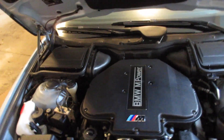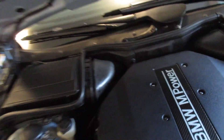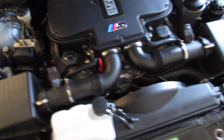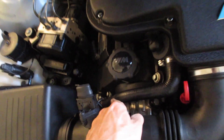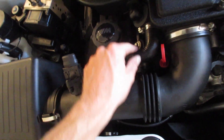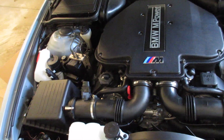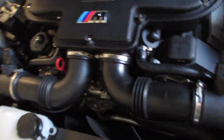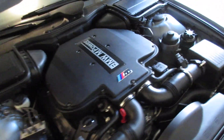I'm really happy with that. It's just one of those stupid little things that didn't really matter but has been kind of bothering me since I've had the car, and now it's how it's supposed to be. I've also spent the last half hour or so changing these oil return hoses here on the upper plenum. I got these from ECS — there's already a DIY on the channel from Andrew, but it's real simple, just two hose clamps. Do it with the engine cold so you don't spill oil all over the place. We've got nice fresh hoses there. The old ones weren't actually too bad, but they were just feeling a little bit weaker and didn't spring back to round form real quick. I replaced all the hose clamps too.